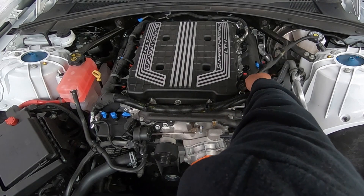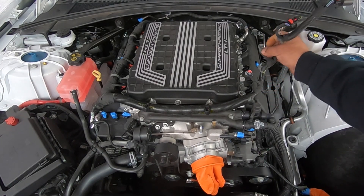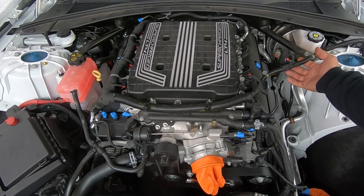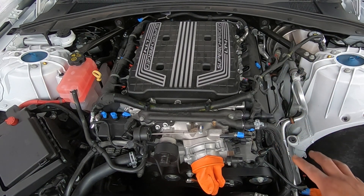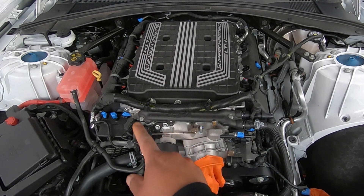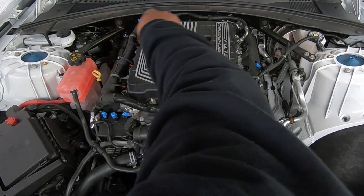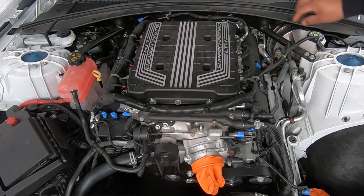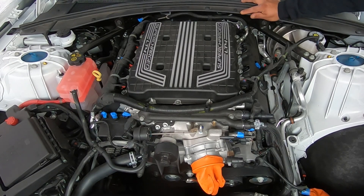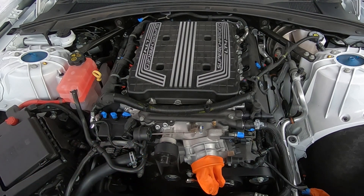We unclipped all the little plastic clips holding on to the supercharger. On this side we removed these connectors from each coil pack because we thought we'd be able to move this harness to the side, but it looks a little more complicated than just those clips, so we're going to leave that alone for now. I'm going to remove the belt and check to see if anything else is holding on, then we're going to remove the lid - it's a couple of bolts, about 10 millimeters, four in the middle, and some all around back here. We also had some clips holding on and we have to get to the MAP sensor back there.